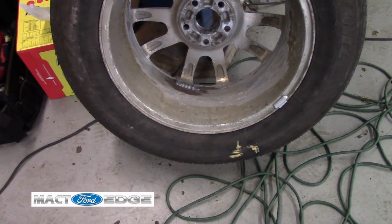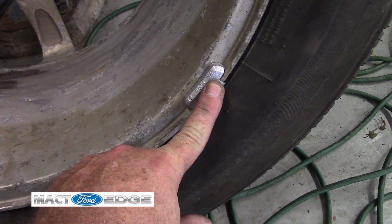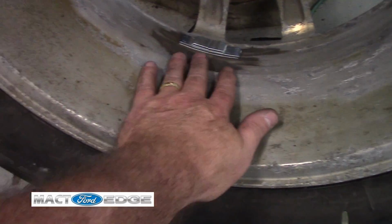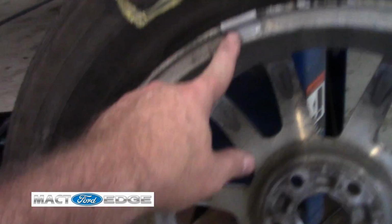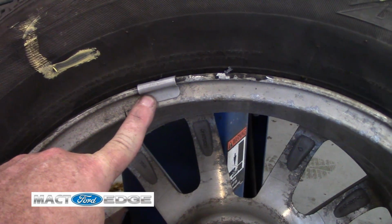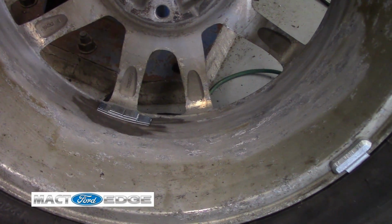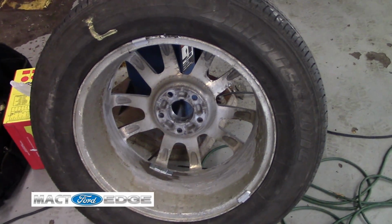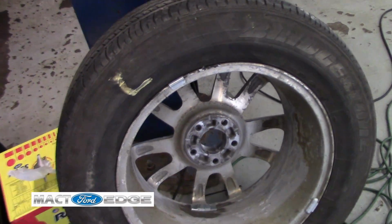I have the left front, as I've marked it, left front tire, and we went ahead and put 3/4 of an ounce of weight here and 1.5 on the inside, so that does come up to 2.25, and then another 0.25 up here, so it comes out to 2.5 ounces for this wheel. It is worn, and this one has been problematic, and most of the time when we work with it, we do suspect that the rim itself is not properly balanced or the tire is an issue, but we've always had historically an issue with this tire and rim.